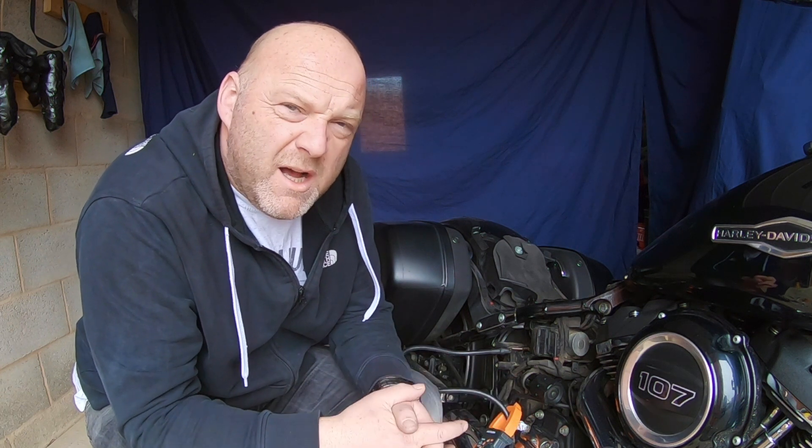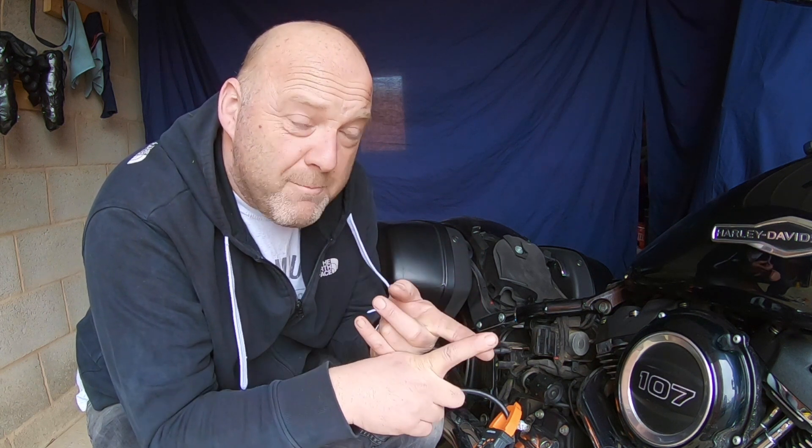When I started the bike, the amperage settled around 9 to 9.5 amps, kind of went up to about 9.8–9.9, so let's say 10 amps maximum. When I put on the auxiliary lamps, the current draw went up to about 12.7–12.8 amps — so that's my maximum draw as the bike stands. You could add all the electrical accessories, USB power, and essentially I've got a maximum of about 12.8–13 amps. Being pessimistic, let's say about 15 amps if I'm powering everything at the same time. Now bearing in mind this voltage regulator should pump out 35 to 44 amps — you can see there's a massive margin there.